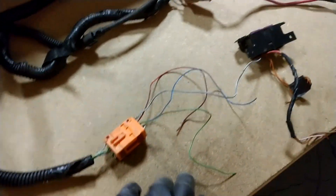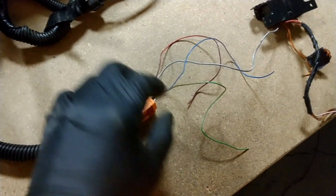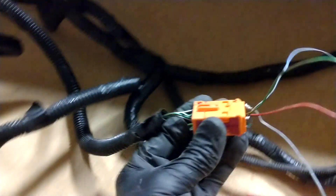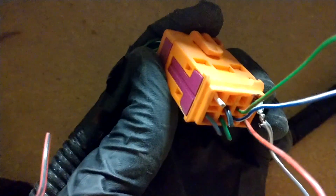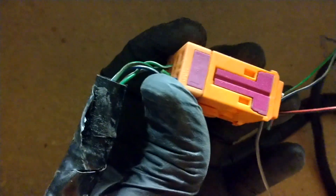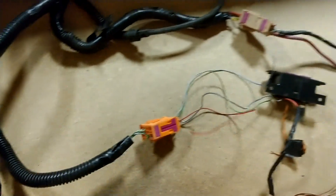The K-line goes into the orange connector — you'll read in your manual which one is the K-line. I had to solder mine because it broke while I was pulling it apart. You can see I deleted quite a few things and left quite a few in. I kept everything for AC, tachometer, and check engine light. One interesting thing: on this side there's a wire coming out of port four — they're all numbered, one through four — but on the engine harness side there's nothing; it was just a dead end from the factory, probably a diesel versus gas difference.